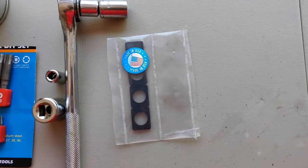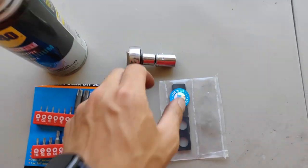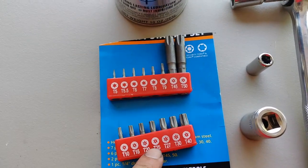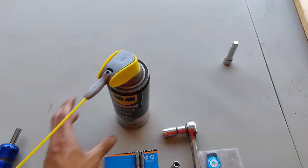You're going to need a couple things for this. You're going to need the bushings themselves that you're going to replace. You're going to need a socket wrench with the 13mm and a 16mm attachment, a Torx set with a T25 and a T50 size. Optional is some grease.